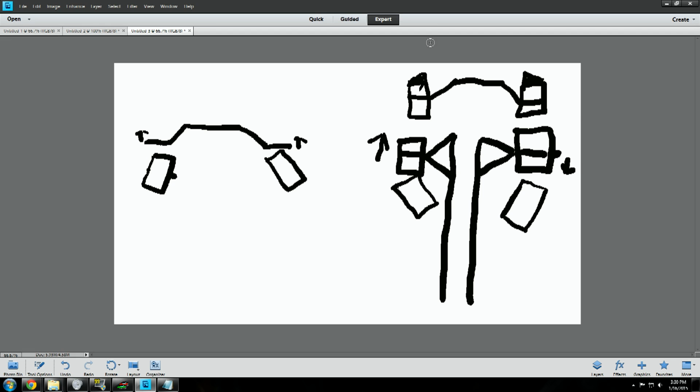What can we do to keep that from affecting our steering and causing our steering to wobble? Because when this happens, your steering is going to wobble back and forth really fast. So what we do is we angle the tires like that, out that way, so that it's always pulling outwards. Even if these get a little bump to them, it doesn't matter because the tire is still angled out just a little bit. It's still pulling in that direction, and this one's pulling in that direction. Yes, they are working against each other a little bit, but the amount is minuscule, so it doesn't really matter all that much.